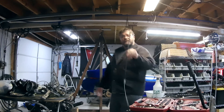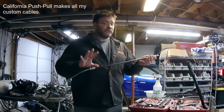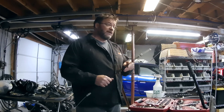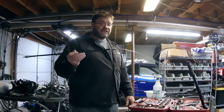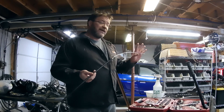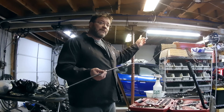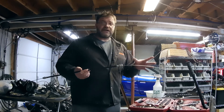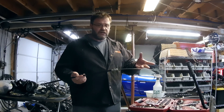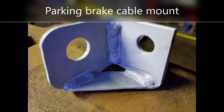One of the key things is this custom cable here — so far it seems like the only custom cable needed to make the Wilwood brake conversion with the mechanical spot calipers work with one cable. It basically needed to be lengthened four inches. I had a brand new driver side and a brand new '88 front cable. I also picked up a few extra parts — the self-adjusting sleeve collar and some odds and ends — and made brackets to mount on the caliper mounts for the cables.